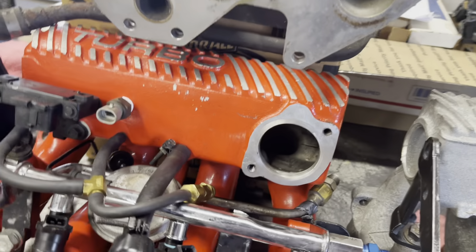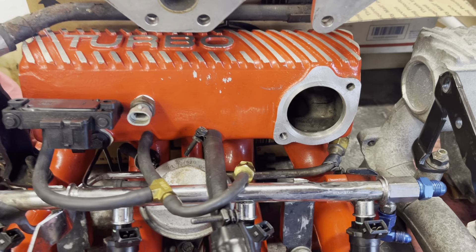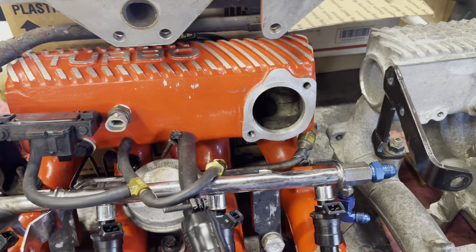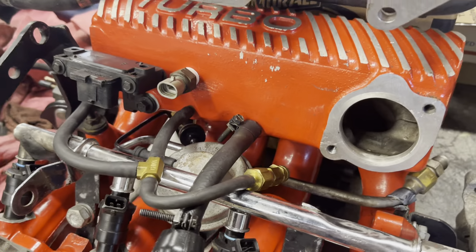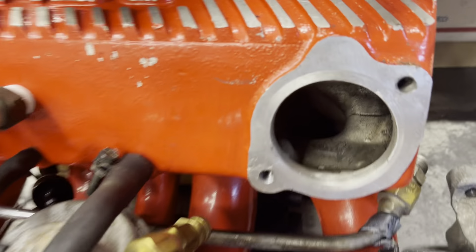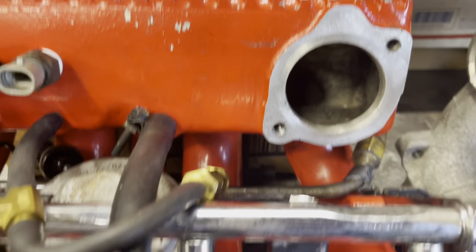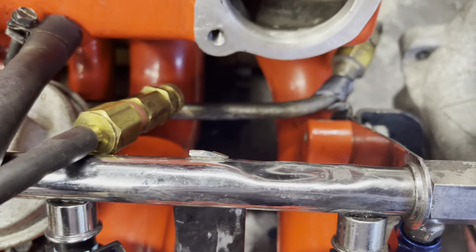One of the first things I did after putting a bigger turbo on was reading that the 53 millimeter Fiero throttle body was a bolt-on swap — which, if you watch my channel, is bullshit. It is not a bolt-on swap. It's a pain in the ass to make it fit. There's a ton of modifications. You have to modify the bell crank. It bolts on the two stock bolt holes, but you need allen head screws because you can't get a socket in there.